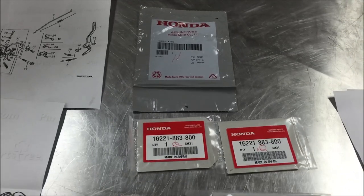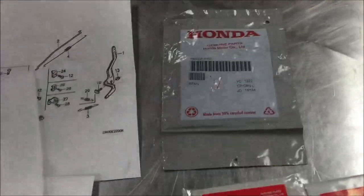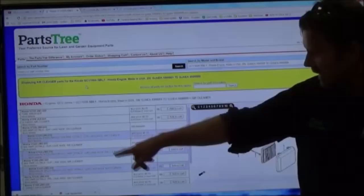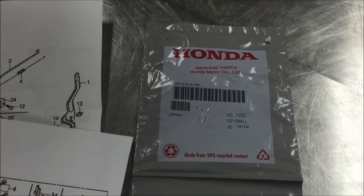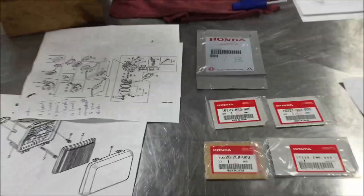Here's the real cool thing to do: take all your parts and label that reference number — number 11 and so on. You can see here that I went ahead and made a quick cheat sheet of what order they go in. Number 11 is starting back at the engine, number five is all the way at the air box — that's my direction order. To connect the dots, go to your parts ordering system, use the microfiche to match up the part number and reference number on the same page, write it on there, and you're going to make life a heck of a lot easier.